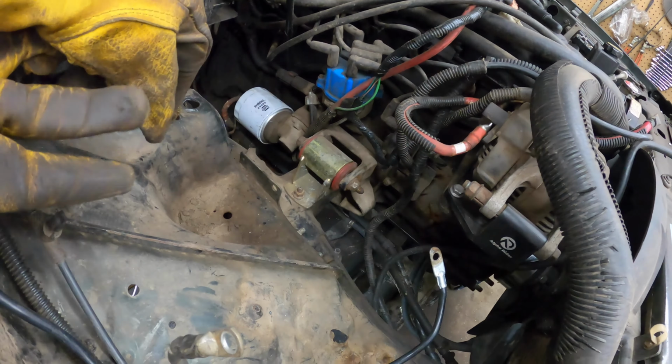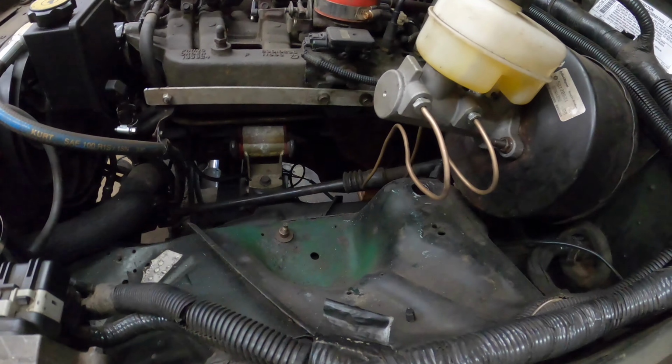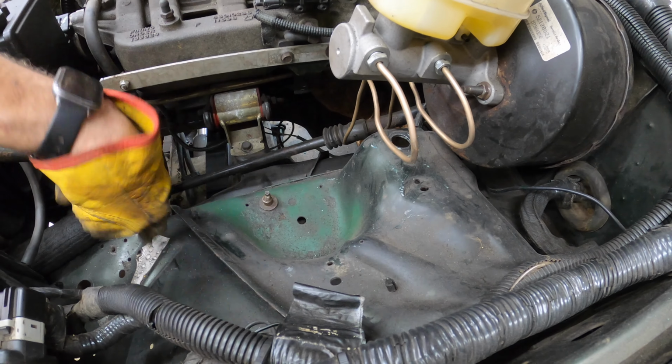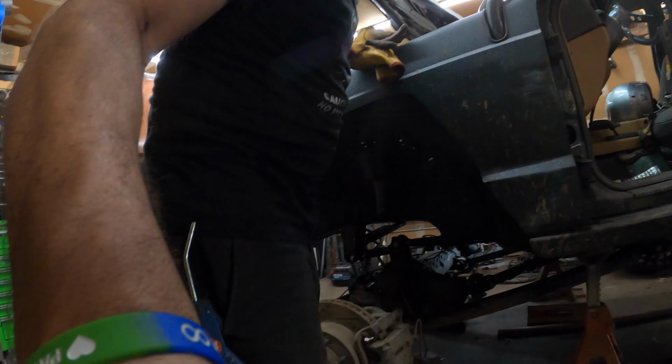So I'm quickly going over the general shape of the holes I'm going to cut on both sides of the vehicle to make room for the shock hoops, and I go into a little bit of description about how the driver's side is a little more difficult than the passenger side, and you have to clear the brake master cylinder as well as the brake lines and the track bar. So time to load up the old Arccaptain, get it ready, and let's start cutting.